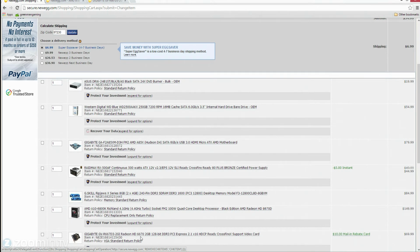Like I said, though, you have to watch out for that frame drop. If you have tearing, then just switch to the 6670, wait for a software release and patch that up. Or if you don't want to wait for that, you could even switch out this AMD A10 with maybe an Intel or something cheaper, maybe an A8 or whatever, and go with NVIDIA graphics or go with a higher AMD. But this is what I would particularly go with. This is the best bang for your buck, because now you could build your CPU up as well as getting better graphics this way. So now you have the best APU possible, and you have a decent graphics card to back that up so you're not just going strictly on the GPU onboard of the processor.